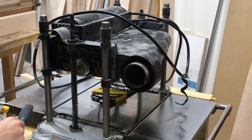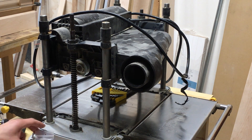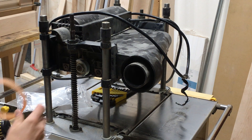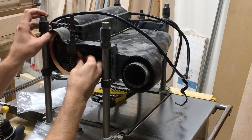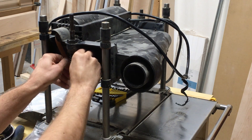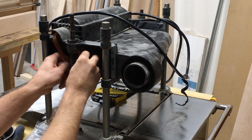About a week later — here's what we found of the original belt, and here is what it's supposed to look like. So let's slip the new belt on, doing one rib at a time, turning it and pushing it on at the same time. It's quite easy to install — there's no tension or anything, it's just a snug fit.